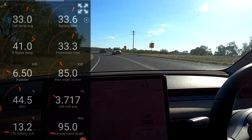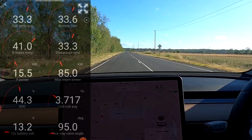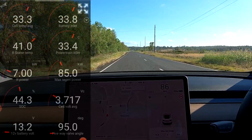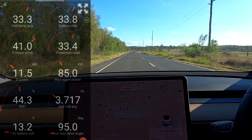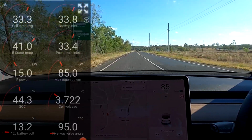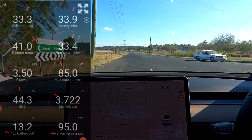And then some people say, well, I don't keep the car for that long, so I shouldn't really worry about degradation. Well, you sell the car to other people, then it goes into the second-hand EV car market, and you should not bust your car knowing you could have preserved more battery capacity by charging to a lower state of charge during hot weather, for example, or in general. I don't think it's a good attitude to say I don't care because I don't drive the car that long, and I just charge to 90% every day, so whatever.